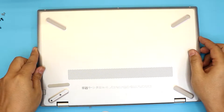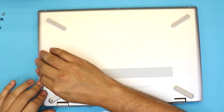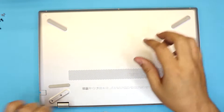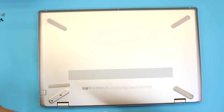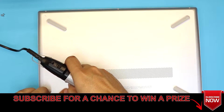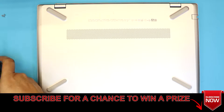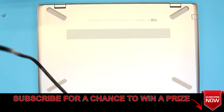Put the bottom cover straight down and push every corner into place. Put the two screws at the bottom — the black ones go at the back side, and the smaller screws go in the front. I hope this video was useful for upgrading your RAM, hard drive, or doing a repaste. If you have any questions, ask in the comments, and I'd appreciate a subscribe.